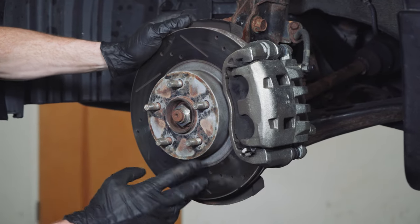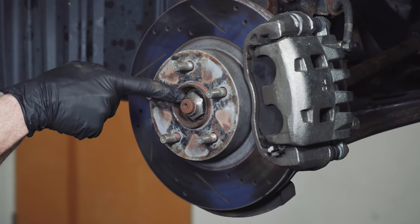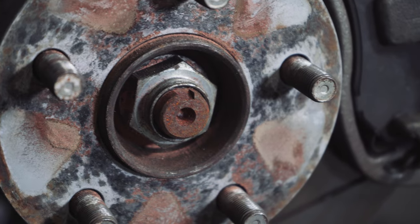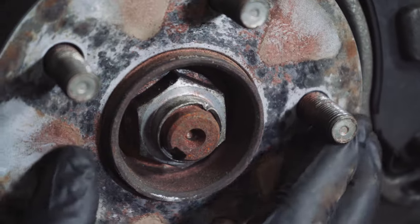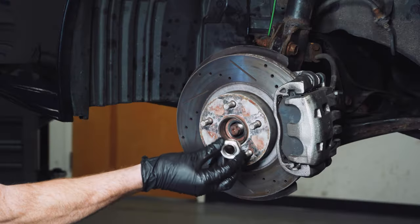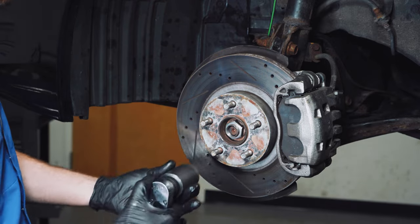Let's get the wheel off and have a closer look. Now that we have the wheel off, it looks like somebody just did pads and rotors and a brand new caliper — I'm sure they probably did it on both sides. Looking at the axle nut, the axle stud itself does have a small slot up along the top. The nut should be peened down into that area — it's not. There's the peen, almost 180 degrees off. That's odd. Why would anybody loosen up the nut if they're just doing a brake job? It's important to install your axle nut and torque it to the manufacturer settings. If you either under-torque it or over-torque it, you can cause some serious damage.